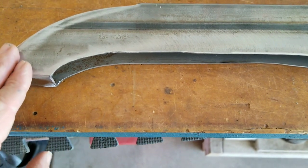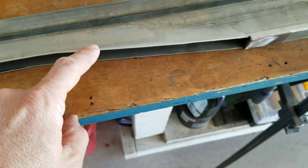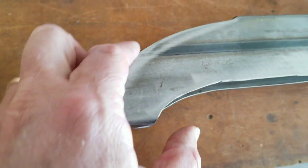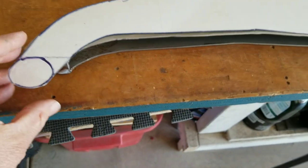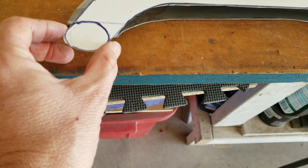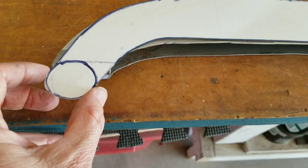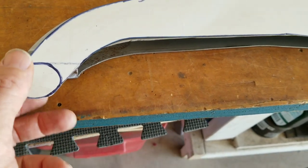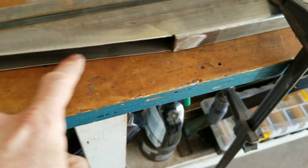With this notch, there's going to be a shackle basically right here, which will be flush to the bottom of the frame. I've notched the bottom of this about one inch up, carried it back, and then started a slight angle down to zero over about 18 inches. The front is cut in a radius — I did a cardboard template for that. There's going to be a piece of round tubing in the front right here, matching the round piece on the actual car where the bolt is for the spring shackle.